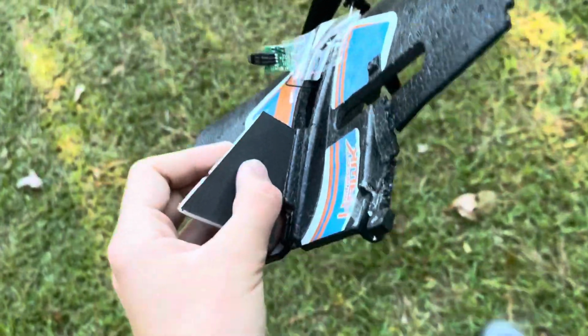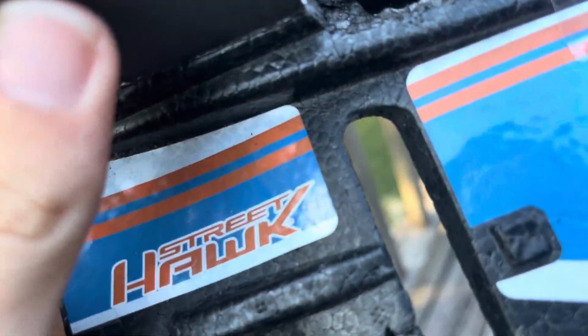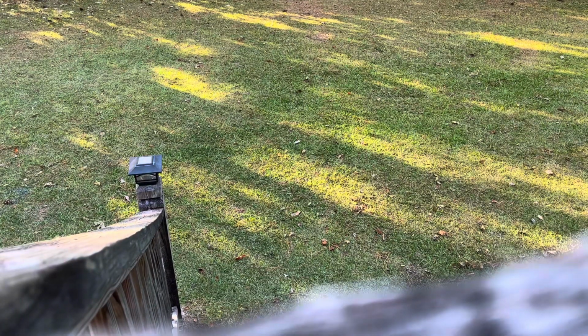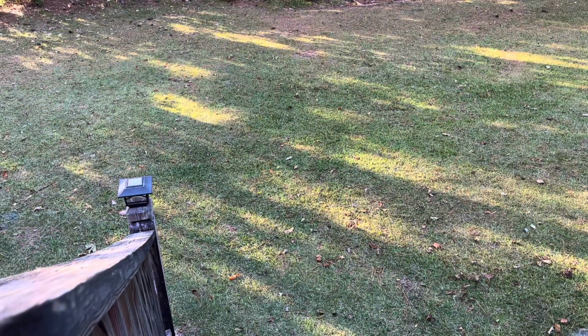Okay, so based on a couple of other tests, including this one, where it looks like the propeller has moved, it seems to be showing a clear nose down tendency. So I'm definitely going to have to give it some more elevator, or at least something to keep it angled up. The CG could be the issue. So maybe I'll just put the servo on there, actually, and just see how it goes. I think I'm gonna try that, actually. All right, now we're trying with the servo. Okay, that worked nicely. Let's try again, because why not?